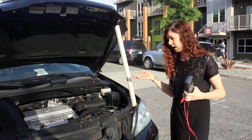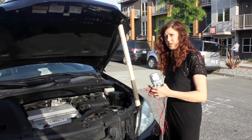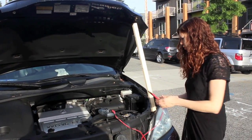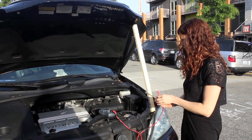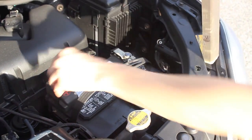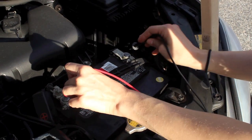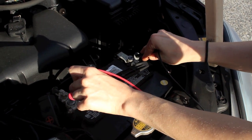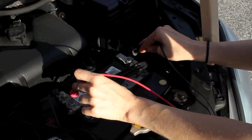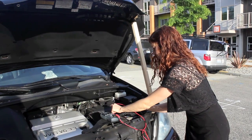You want to locate your battery and then find the two leads on it. Almost always, cars will have the positive lead marked with a plus, and then the negative lead will just be exposed metal contact on the battery. So if I pull the red cap off, I can go ahead and check my battery. 12.52 volts — that's my car battery voltage. Easy.